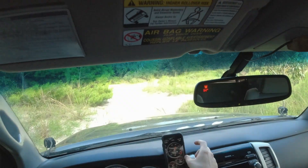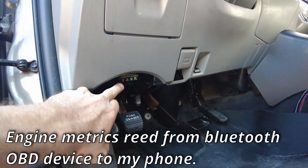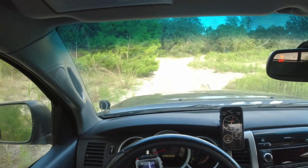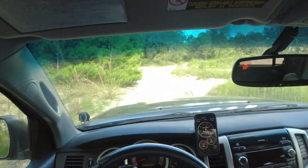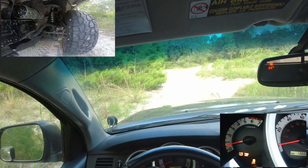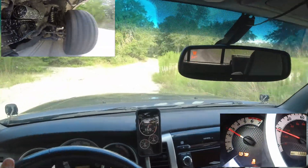All right, so here about to do our first run. First run is going to be four-wheel drive with street pressures. I'll be running the engine metrics the whole time — engine coolant temperature is 188 right now and transmission pan temperature is 147. I'll turn the AC off. The truck will be locked in first gear the entire time. What I'm going to do is a torque stand — foot on the brake, one foot on the gas, build up RPM to about 2000, and then take off. So: four-wheel drive, street pressures, 2000 RPM on the tach, let off the brake — we're off. Fair bit of axle wrap there.